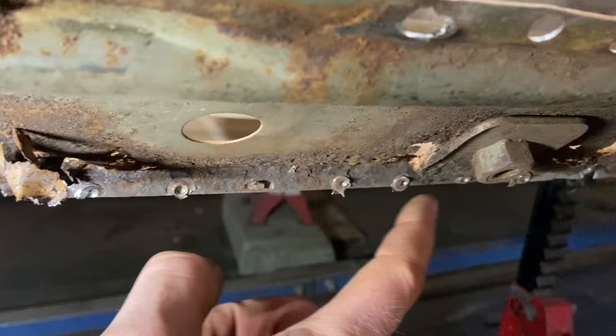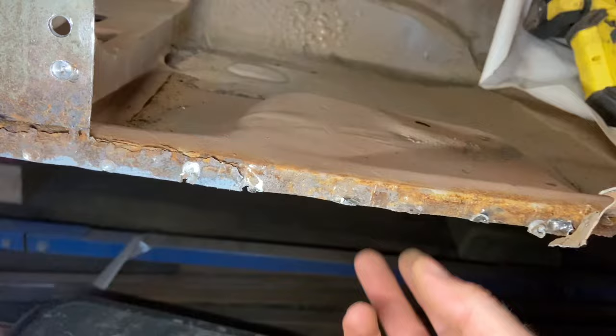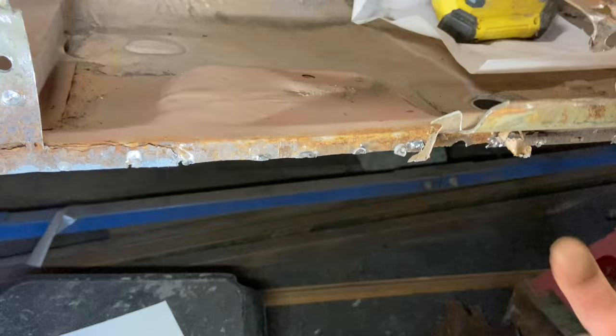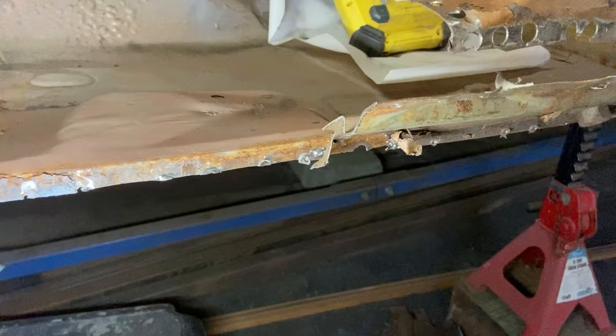they've used for the inner to the floor pan. Thinking back, of course they put the inner sill on not at the same time as the outer sill. So there we go, at the factory you've got different spot welds, not one that does all three panels, I think. That's what I'm finding anyway as I'm going along. I'm finding separate dimples to the ones I thought I'd be drilling out.